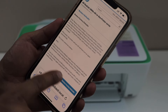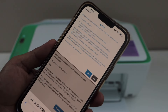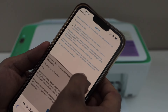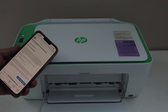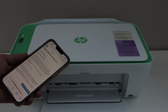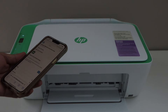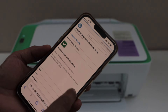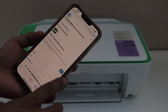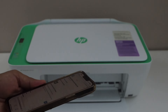On the next screen, again click on restore factory defaults. Here is the final confirmation, so click on yes. It might take a minute or two minutes, maybe a little bit less or more — it just depends on the speed. You can see the factory defaults reset is done. Click ok and your printer will restart again, which means it has been reset to the factory defaults.